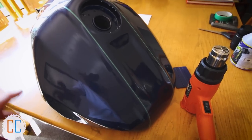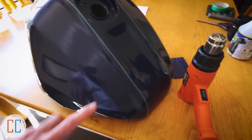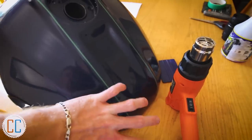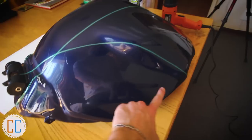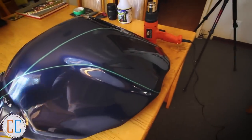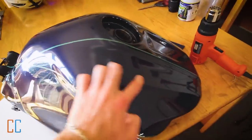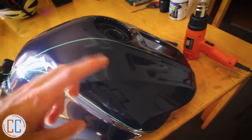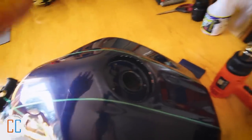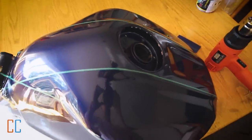I just laid the knifeless tape to get an idea of what the stripe would look like and where to lay what pieces of vinyl. These two will cut for the red stripe but at the very end — first I'm going to do this section with white, then pull this one, lay another white piece here, do the same on the other side, and then finally do the red stripe last so that it sits on top and looks the best.